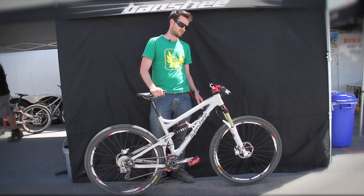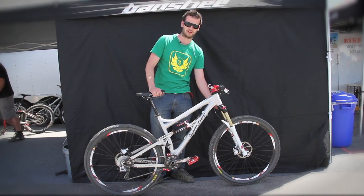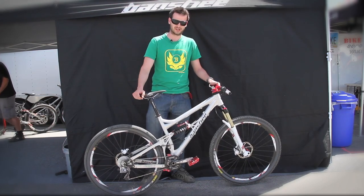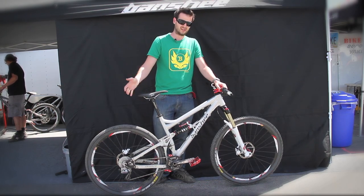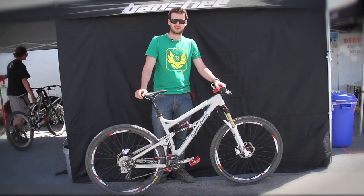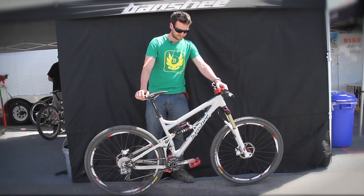This bike is designed to ideally work with something around a 120 to 140 millimeter fork. Here we've got a 140 in the front from Manitou, a prototype fork as well. I'm sure you'll see that elsewhere. The frame itself is, as always for us, 7005 series aluminium. It's about 50% better fatigue strength and overall 10% stronger than 6061. Much stronger frame overall, with a longer lifespan because of that.